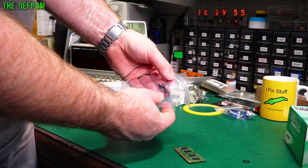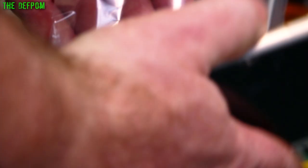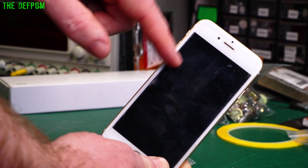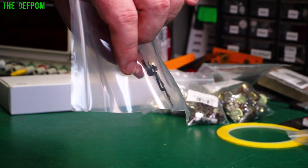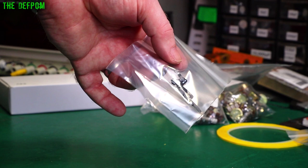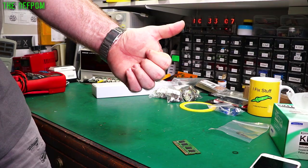So this is a flex cable for an iPhone 6 — an Apple original one, salvaged out of a used phone. It's the volume buttons on the side and the mute switch. On this particular phone they're broken. The screen protector is cracked, there's liquid damage behind the screen, the screen is needing replacement too, and the dock connector is broken. Those buttons are broken because of the liquid damage. I ordered this part from China four or five months ago and it hasn't arrived — then I ordered another one and that hasn't arrived either. I managed to find this one locally. It's a used part but at least it's Apple original, and it wasn't actually that much more expensive — about five dollars more. I've had this phone sitting for ages because of that; I really need to give it back before Christmas.